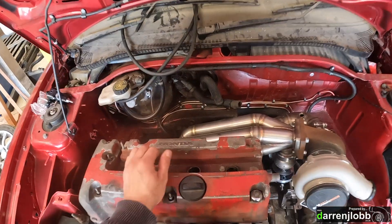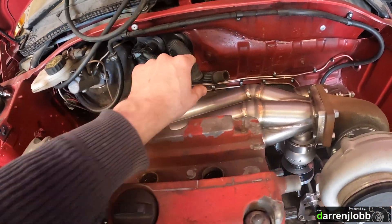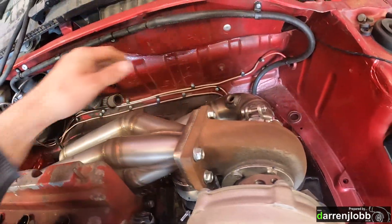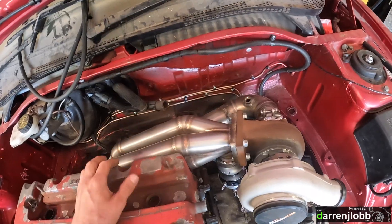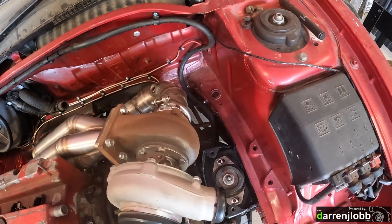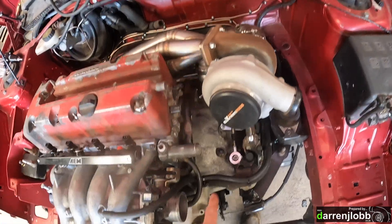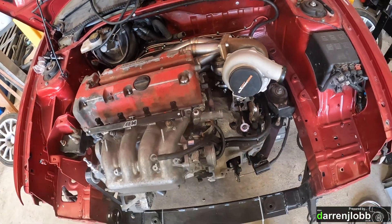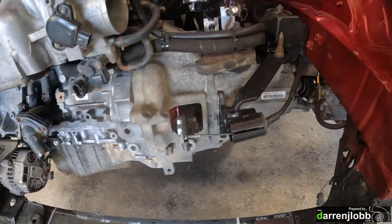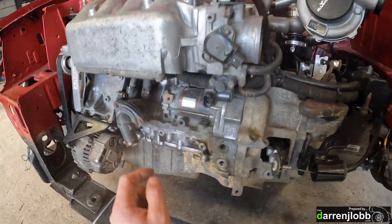I've also mounted the heater hoses - I've cut them shorter and come up with a rough idea of what to do. I think we'll run the heater hoses right across the back of the bulkhead, clip them back nice and tight to keep them away from the exhaust. I think we'll probably end up heat wrapping this exhaust anyway, but I want to keep the hoses well back. If we haven't got enough room we'll have to shorten some of the steel pipes and route it slightly differently. I've got the starter in there now and I've run the main battery cable around, and I've still got to wire up the alternator as well.